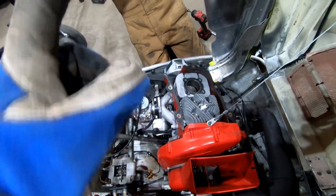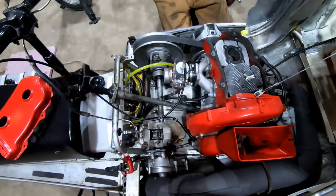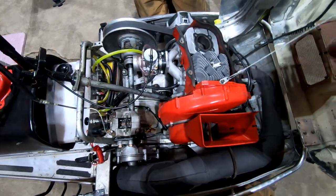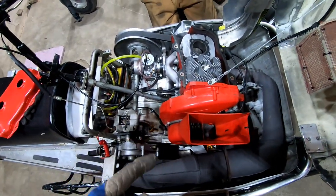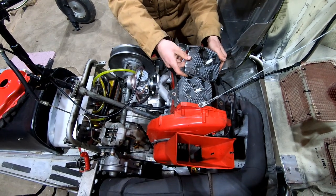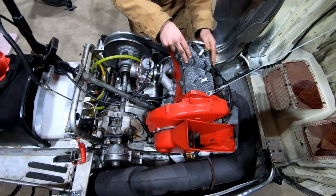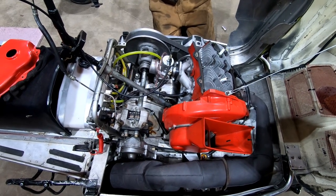When you hone it, it might kind of pull some material into there. It's already 20 over too. You might have to bore 40 over. No, it might be able to clean it up. What you gotta do is find a piston that works. Why did it crack a piston though? A leaky head gasket wouldn't cause that, right? Maybe. We're just, I mean, these exciters are just dicks, dude. Let's say we get the cylinders from Easter. I'm sure they're ported the same damn way. Maybe this thing's just a lost cause. What a turd nugget.